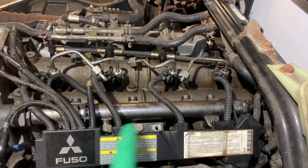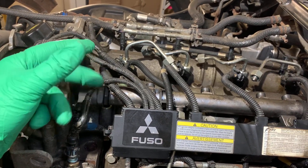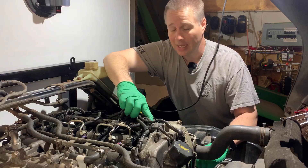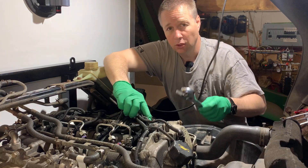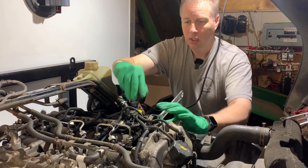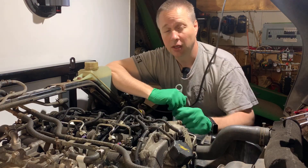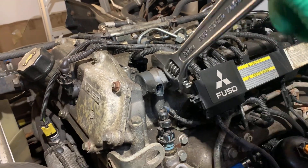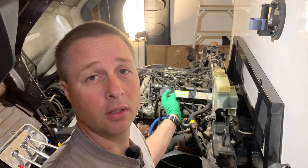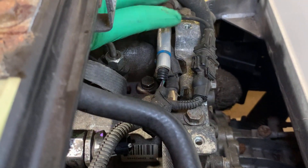The rail is held in place with a bolt here and a bolt in here. Before I loosen those off I want to loosen this off first, otherwise there won't be anything to stop the rail from rotating when I'm trying to undo this — and the same back here for the pressure sensor. To get the regulator out you will need about a 30 millimeter wrench. I'm using my metric adjustable but you do have enough space for a wide wrench to get on there — it is slightly larger than the outside diameter of the rail. Make sure you unplug the electrical connection. To make removing the rear sensor easier, we're going to remove two 13 millimeter bolts to remove this bracket, because with the bracket removed we can get a 27 millimeter socket into the back.